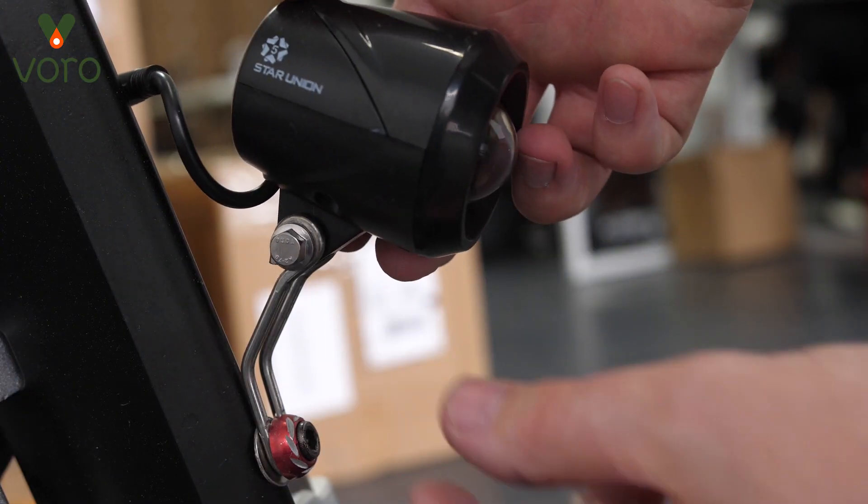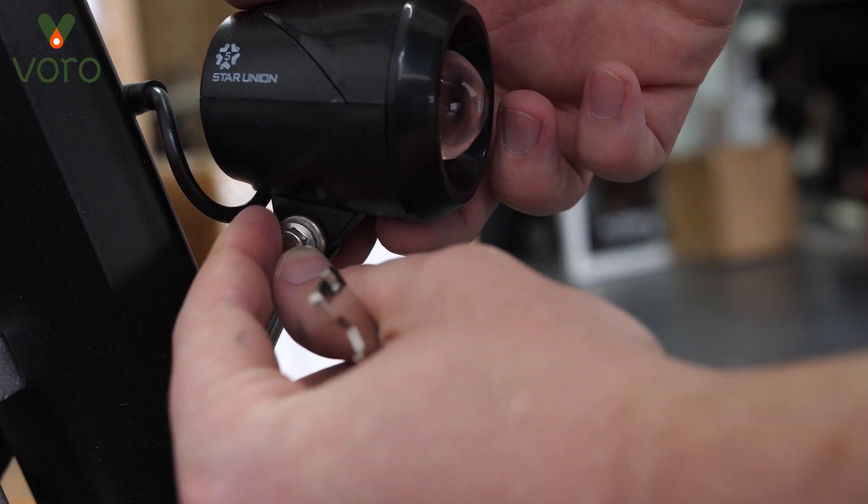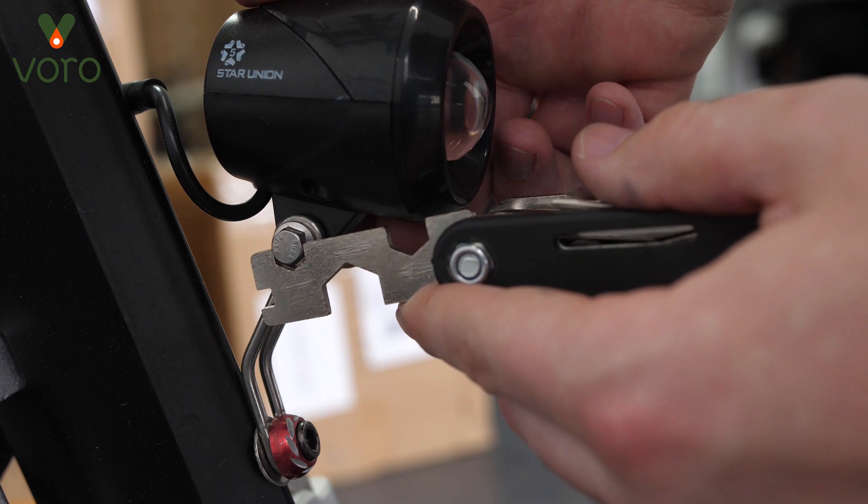Next is the lamp and horn on the front. It can be a bit wobbly but it's a super easy fix — tighten the bolt with an eight millimeter wrench and you'll be fine and ready to go in no time.